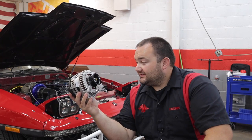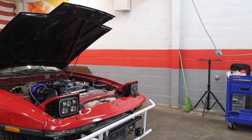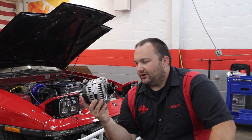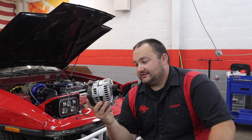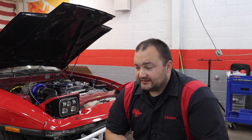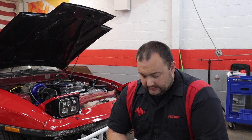So today we're gonna fix that. This is an alternator for a 2005 Lexus SC430. There are a couple different alternator upgrade options you can attempt to install on the JZ. There are aftermarket ones that bolt right up without modification putting out a ton of power, but the stock 1JZ alternators are only like 80 or 90 amps — same thing goes for older 2JZs. Some people said the alternator off a V8 Sequoia or 4Runner will bolt up with minor modifications, but the wiring for their plug is a four-wire plug, so wiring is more involved, and it was just a few dollars more.